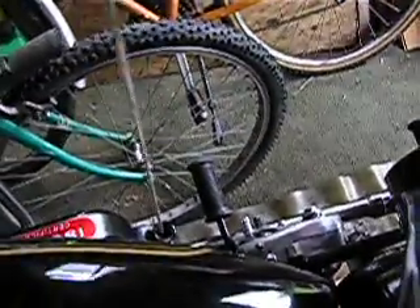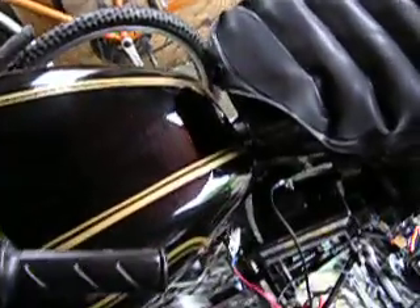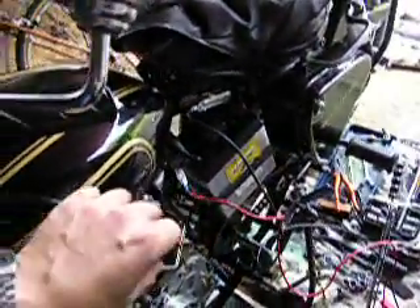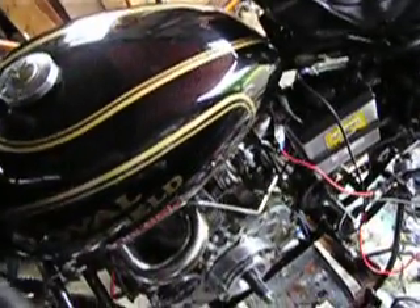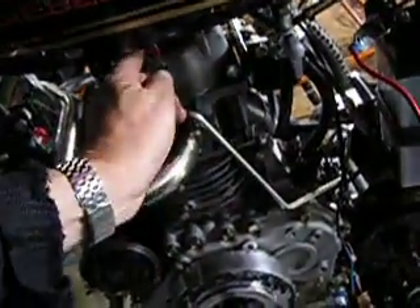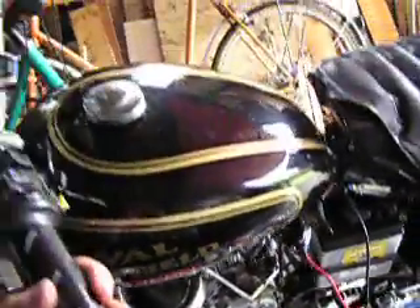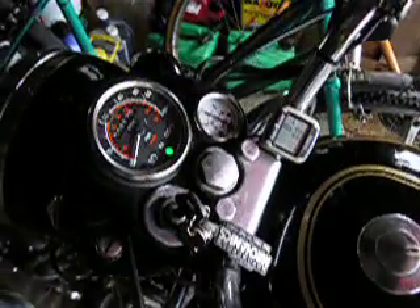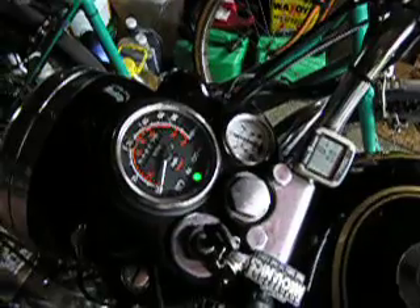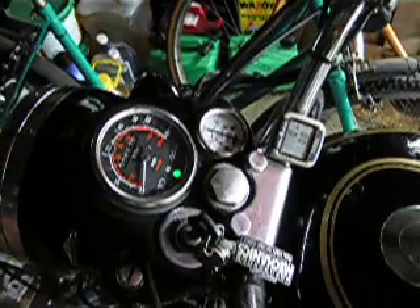Now, I must make sure I go over and get the engine to compression point. That's not too bad. Let's move the handlebar out of the way a bit. So, the decompressor on. My low oil pressure light is on. I'm using the spare green neutral light — it does as a go-no-go indicator. If you see it on, it's no-go when the engine's running.